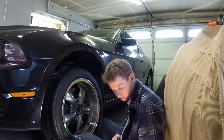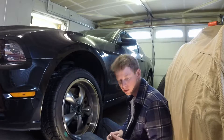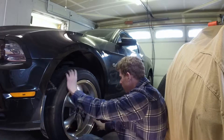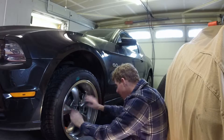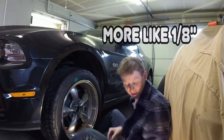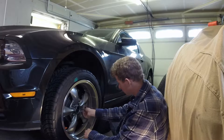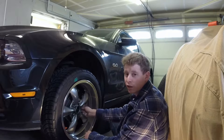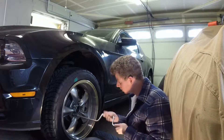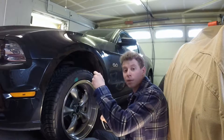I also got new wheel locks for this as well — I think this came as part of the kit. I'll link the kit down in the description for all you Mustang guys watching. These wheels just barely fit — I'm talking hundredths of an inch. I did check the size and they do fit, it's just these brakes — the brake caliper is very, very close. I'll show you guys later. These are no longer 21 millimeter lugs, they're now three-quarters, so just be aware of that when you buy wheels — the lug size is probably going to change.